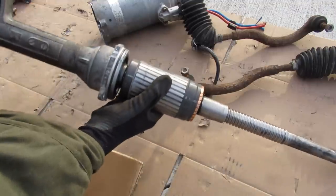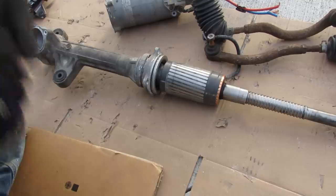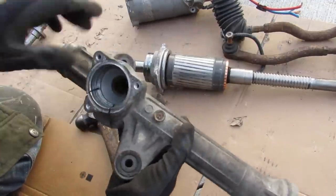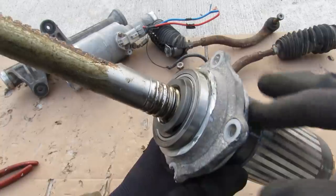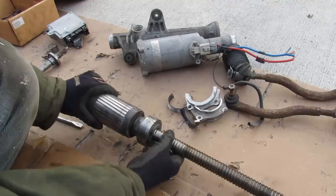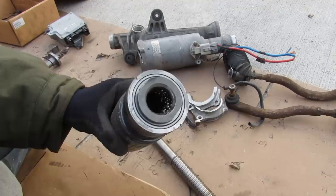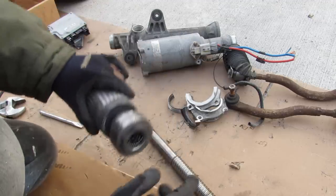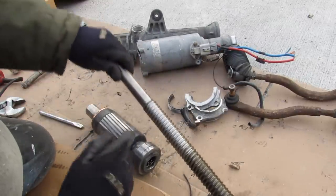The rack part does not want to come out of this housing, so I'm going to have to cut it. This is what the rack looks like — it's got its own built-in bushings to bolt it to the subframe and it's made of aluminum. Bolted to that housing is a bearing, which allows this rack to rotate with the motor on the inside relative to the housing. With that free I can just unthread this rack and it comes right out. You can see inside it's a recirculating ball style — it's got little balls that move in this spiral, and as this rotates it moves against the spiral of the rack, and that's how you turn the rotational motion of the motor into translational motion of the steering rack.